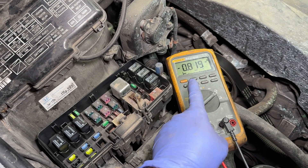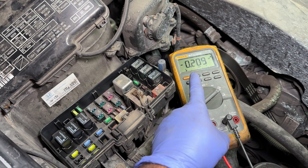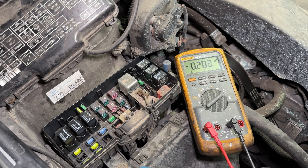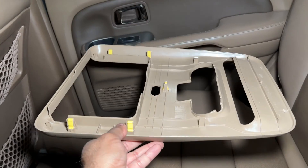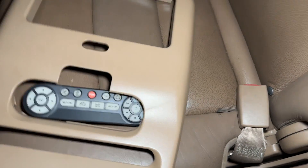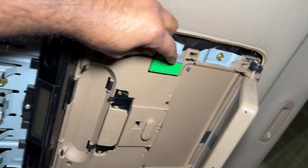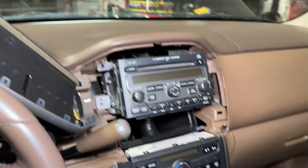Right now the audio unit is powering up. The center screen with the controller was the easiest piece to access, so I unclipped that piece — there's only one connector going into it. I unplugged it, went back to the multimeter, and found no change; there was no decrease in amperage, so I moved on to the audio unit next.